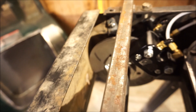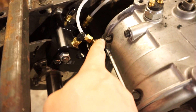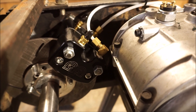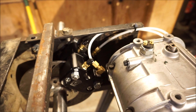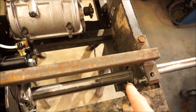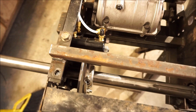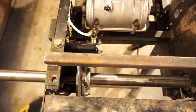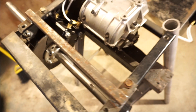Here's what the brake rotor setup looks like — it's ridiculously close to the rear drawbar but it doesn't touch; you just hear it touching the brake pad a little bit. I had to use a compression street 90 fitting since there wasn't enough room. I still need to be able to reach the brake bleeders — I can just barely do it, and of course the bleeders have to be on top. I'm going to use aluminum tubing to make spacers that go between the frame and the hub on both sides. I'll also run shaft collars on the inside of the brake hub and sprocket hub so it won't move side to side and the keyway won't slip out.